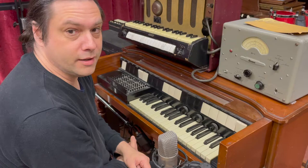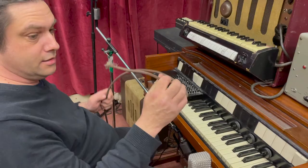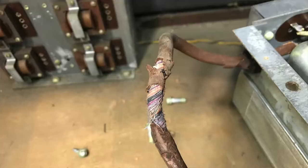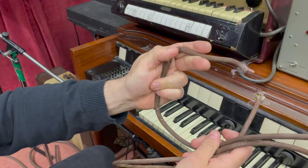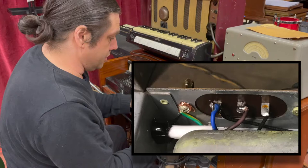I've only just opened up the back of this thing because I've had it for quite a few years. I noticed recently that the mains cable had started to corrode, and I found out it was doing that all inside. So I've put a new mains cable on and earthed it as well — it wasn't earthed either.